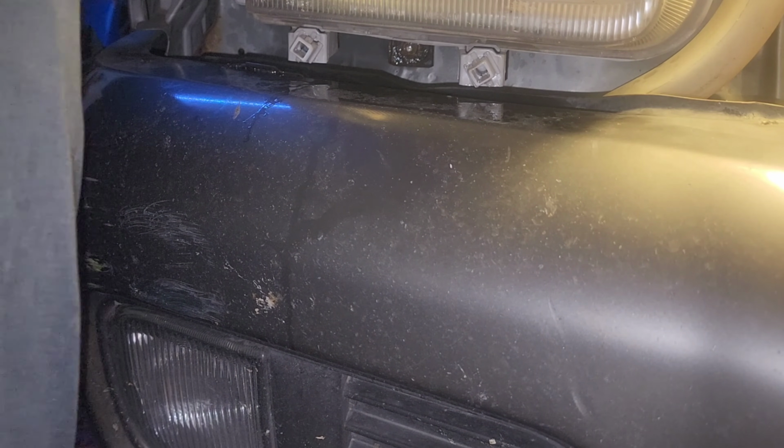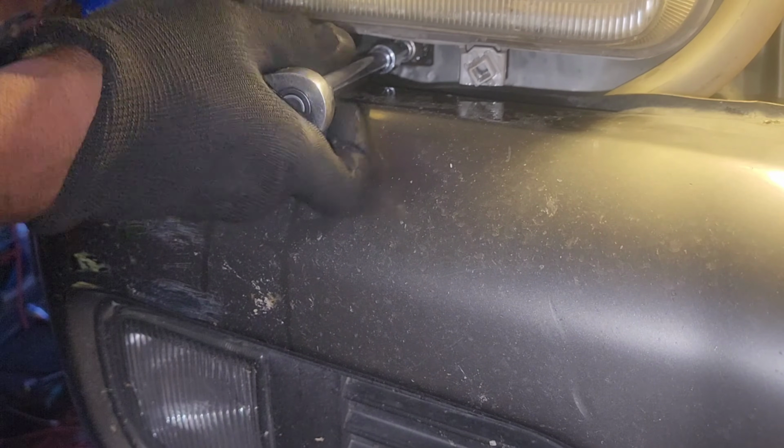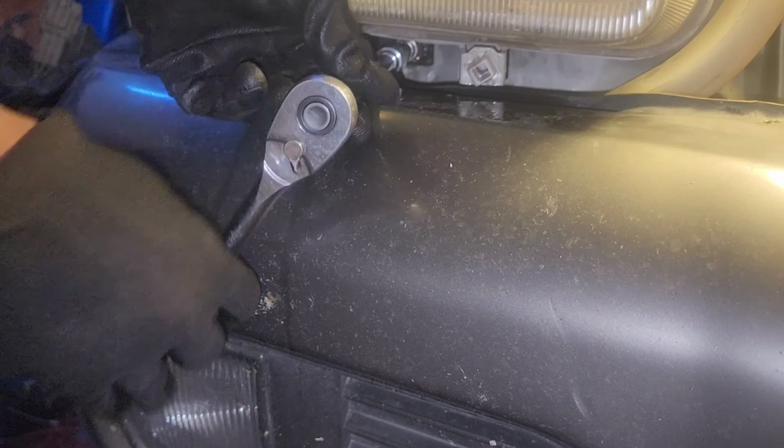I'm gonna reach around the back side of the headlamp and unplug it. So if you were asking me a while ago, because they were having an issue with removing the connector, it turns out that the first time I worked on this, I actually did it wrong. So on the connector, if you feel around on the right and the left side of the connector, there are going to be these two tabs. You have to squeeze those tabs, and if you're doing it right, that connector can and should and will come free right from the back of that headlamp bulb with very, very little issue.